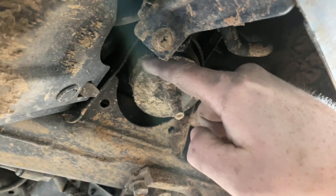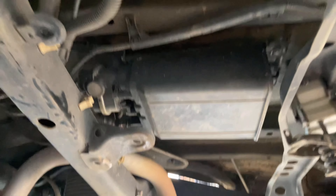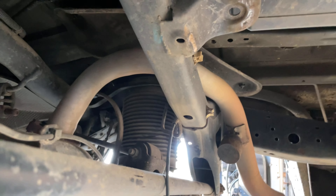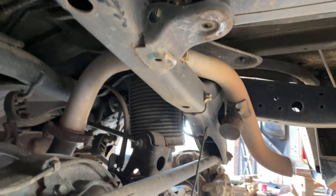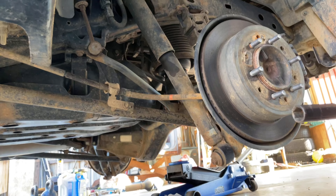Tie these out of the way with a zip tie — you don't need them anymore. Up in here there are two little air reservoirs that just help keep pressure on the air springs. One of the lines runs to them. You don't have to get them out of the way, but follow this — unplug all these. This is where the other airline would go. Follow it all the way up to the top of that spring, remove its clip, thread this through or cut it since you don't need it, and pull it out of the way. Then we'll disconnect the sway bar link on that side, take out that OEM strut, and then we will put the new springs in.